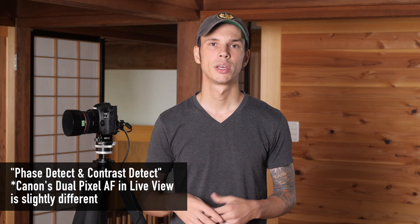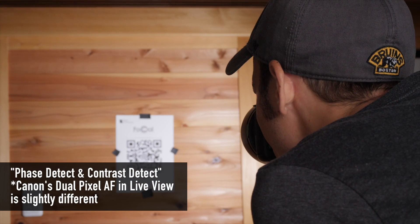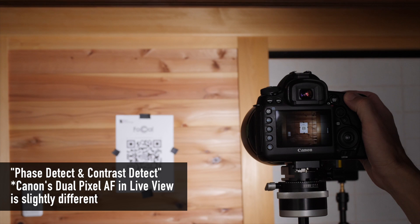Today we're talking about DSLRs, not mirrorless cameras. DSLRs actually have two autofocus systems in them: one that is active when you're using the viewfinder and the other that's active when you're using live view. The autofocus on the live view side is using the same image sensor that actually takes your picture, so if that sensor says your image is in focus and then takes the picture, the results will be exactly what you should expect.